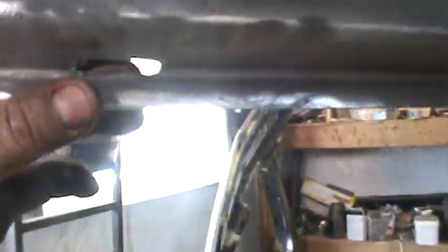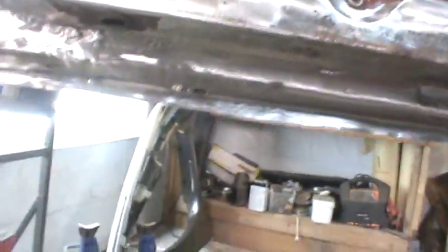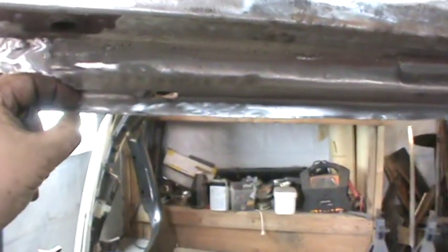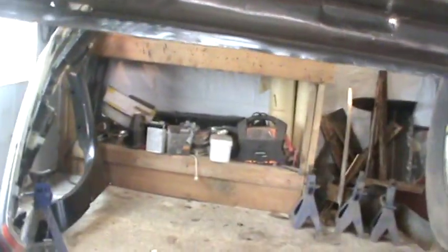Because if you just use your 20-gauge and that's it, it's not very strong. So I folded it in. When I'm ready for my door skin, I'm going to put a piece of metal in here and put it in place, so when I flip it or start rolling it in, it's going to have an edge like that. See how thick that edge is? If I didn't do this, that edge would be much thinner, and that's not ideal.